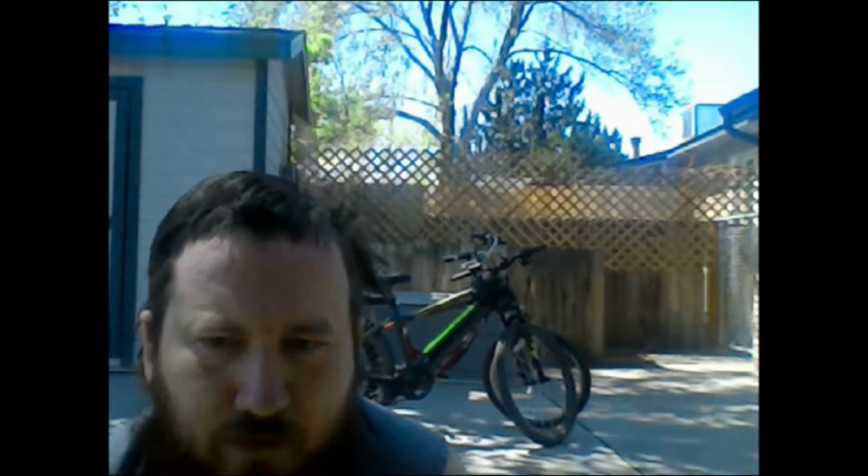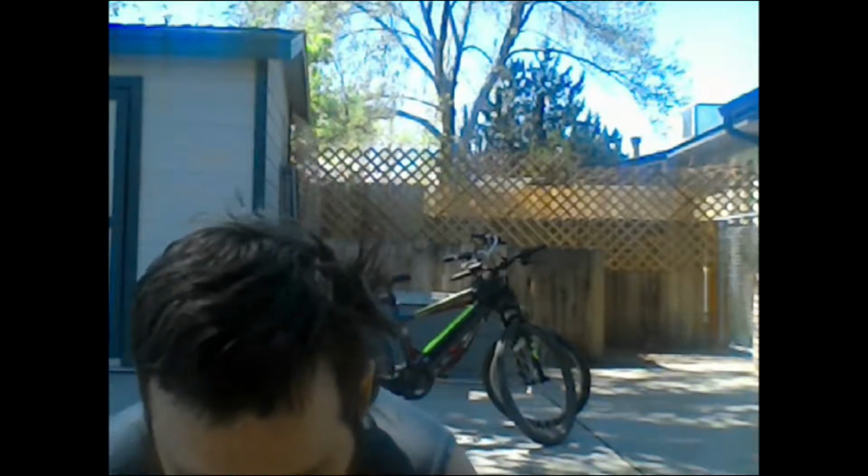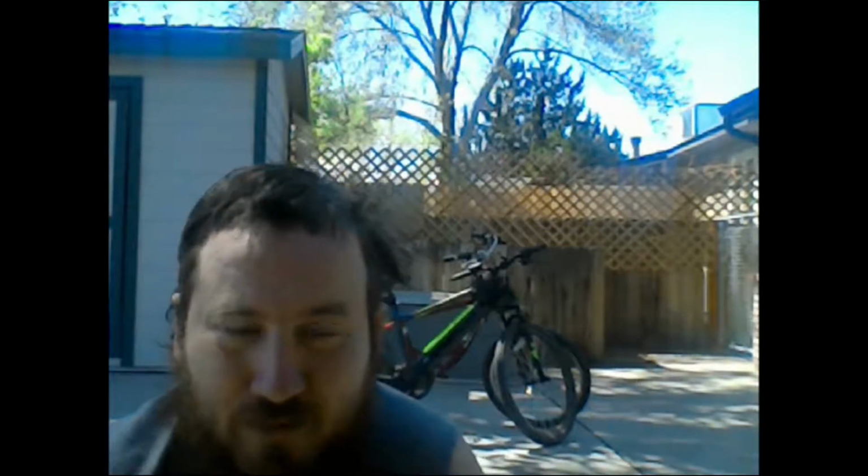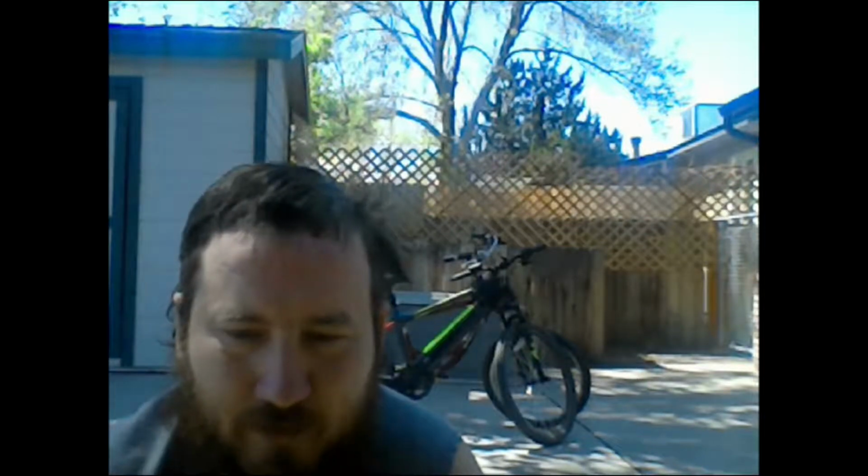And not to mention, freewheels are actually a lot cheaper. For just swapping from one freewheel to another, you can buy one for like $20 pretty easily. So the difference there is quite night and day. But I mean, it's cool. You have more gearing, especially with cassettes. I think the highest you can go for a freewheel is 7, and a cassette goes from 8 to 10.